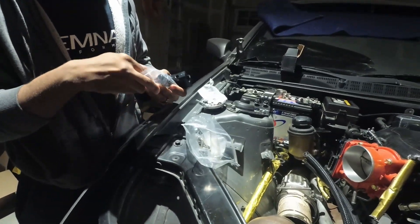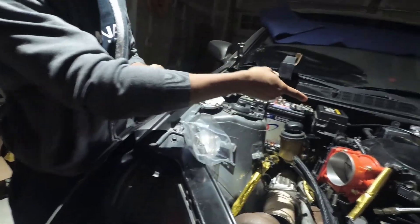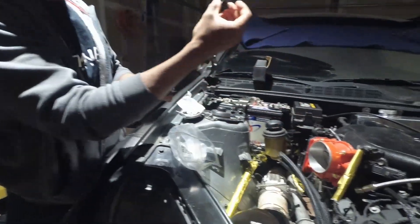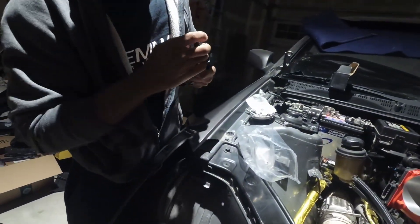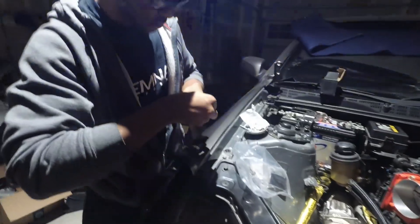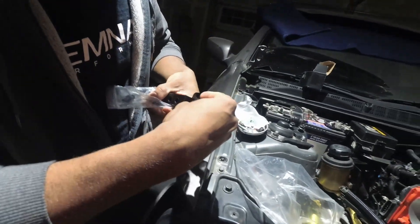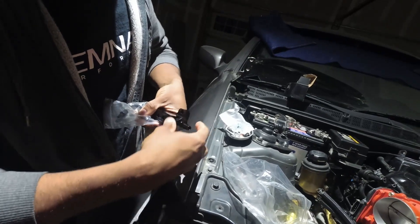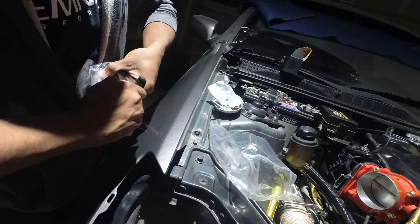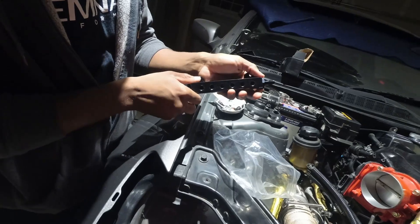The other one, on the other side, we need the feed — which is what's going to bring in from the intake manifold. So coming from here, we're going to tee off and come into this. Let me make sure I clean up the threads a little bit. This one also has the rubber o-ring, so we'll come in there and tighten this down pretty good. We'll go ahead and tighten those in a second.